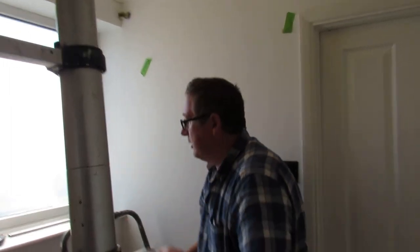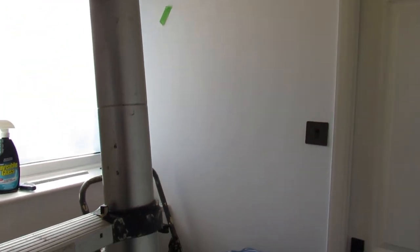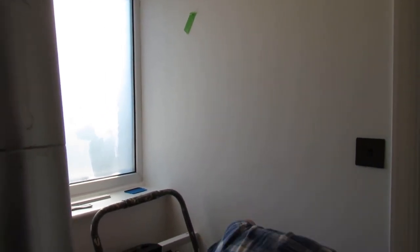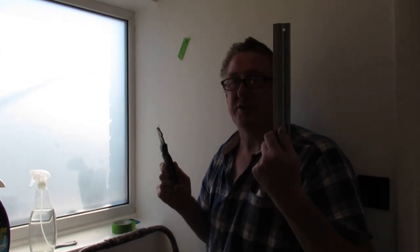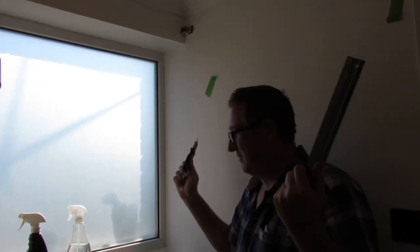What are the key tools you'll need? The absolute minimum: a tape measure — one that doesn't measure short. A plastic scraper to make sure your window is clean — when using it make sure the window is wet. You definitely need water in a spray bottle. Some masking tape to hold the film on while you spray it. A utility knife or Stanley knife. And get yourself a safety ruler — you don't strictly need it but I would suggest it. It makes cutting a lot easier and you can see it gives quite a neat edge.